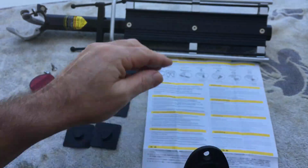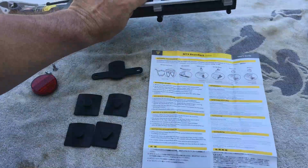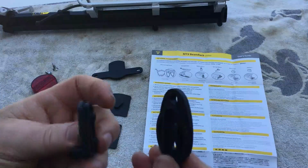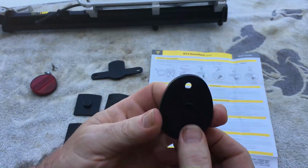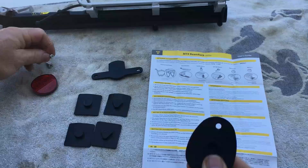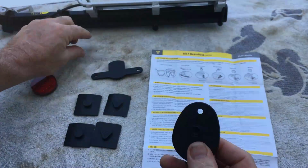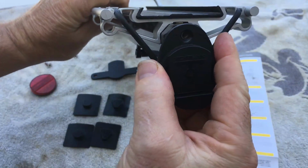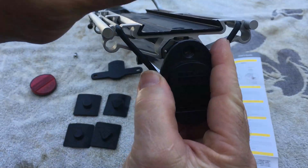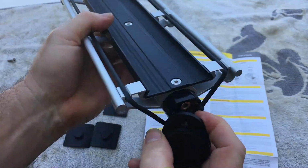I went ahead and already unscrewed this. As you can see here in the back, I just took that off there, and depending on what type of light mount you have, you just clip these on here. You can see in the back, you put on your Phillips head screwdriver and just mount this in back here, and then take this, just line up the holes, and then back here you'll have a hex screw that goes on, and that's a 3mm screw. So those are pretty easy there.